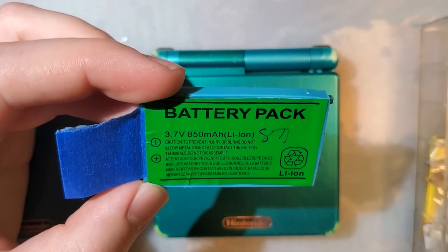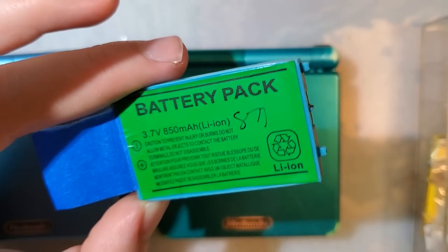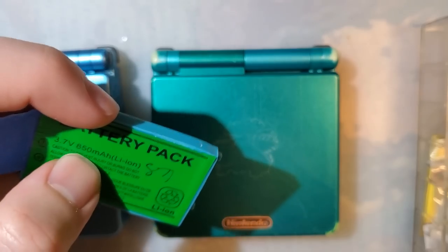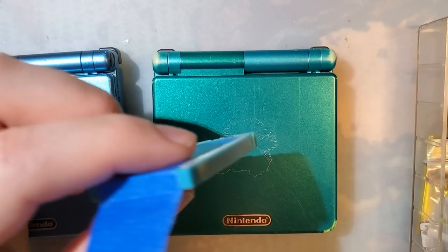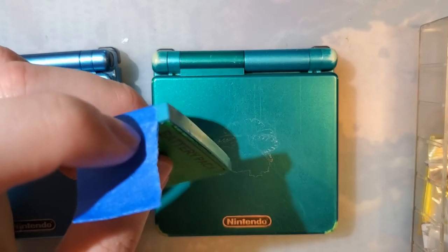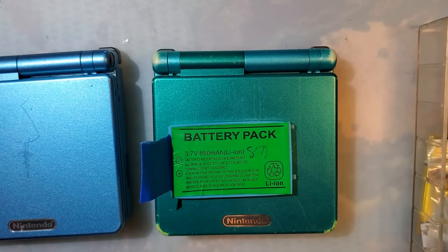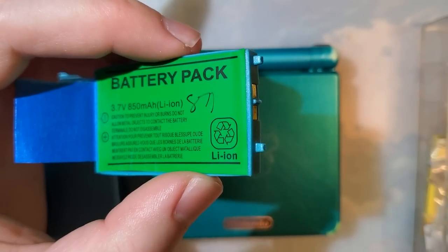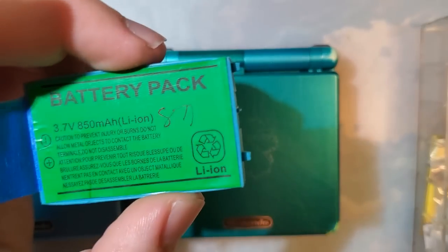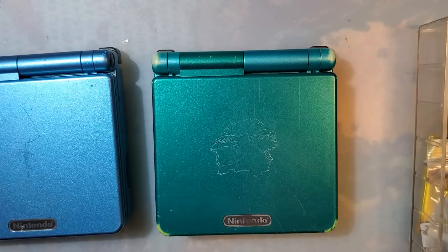The highest capacity I measured was 880 milliamp hours. The lowest was 849. So, okay, yes, that is technically lower than the stated capacity, but we'll call that margin of error. This is why I always run several tests and then just throw out any data that looks off. But my average capacity was 863 between both the batteries I ordered. This one obviously tested above the other one.